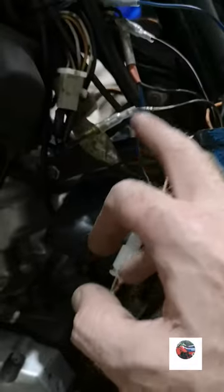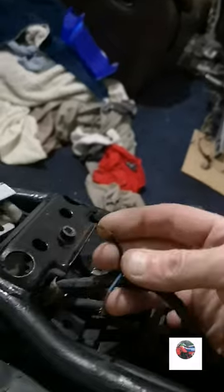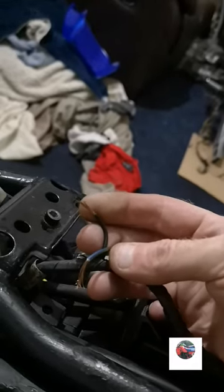Oh, I've just remembered the CDI isn't rigged up. So that's the CDI rigged up now. That way it wasn't rigged up, I took that off. But they're rigged up now. We'll just have a look at the spark. That's the spark in neutral, because it would run in neutral with the side stand up. Like when they're disconnected, that's as if having a neutral with the stand up.